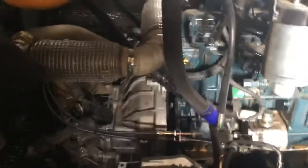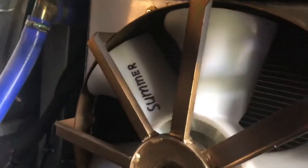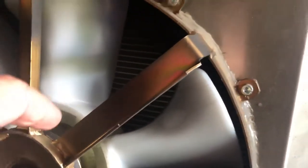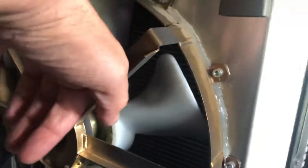An interesting thing about how it's cooled: it has a fan on it, and right now it's set to the summer fan. The summer fan makes the air go through the radiator and blows it directly out of the vehicle, away from the cabin. In the winter, you take this fan off and put a different fan on that blows the air the other way - into the engine compartment and out through the screen on the opposite side, warming the engine to make it more efficient in the winter.